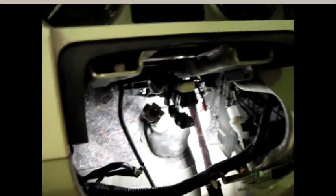Next we will install that motor back in here. You can see it pivots on that mount in the back that I pointed out earlier. The shaft back there hooks up right behind the motor — you actually have to bolt that on first before you put the motor assembly in. We also have a few electrical connectors that have to be hooked up. That one there is kind of our power feed, and this one over here carries the power, ground, and communication lines that power up the module controlling the power steering.